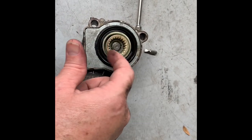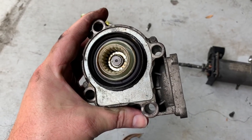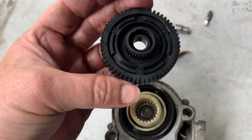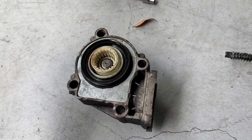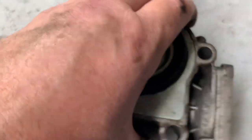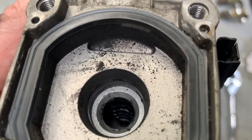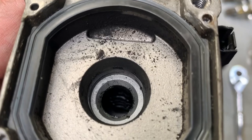This worm gear is not your problem. The problem is going to be a gear inside. Once you've got it separated, this is basically where I'm going to show you how to do the job for free. Normally, you're going to see somebody want to go and replace this gear — you can get one on eBay for $10, $11, $12. But my suspicion is the BMW original gear is going to be a much harder, better plastic than the aftermarket. When you pull this apart, notice the flat spot on the gear where the worm gear has worn down the main gear inside.